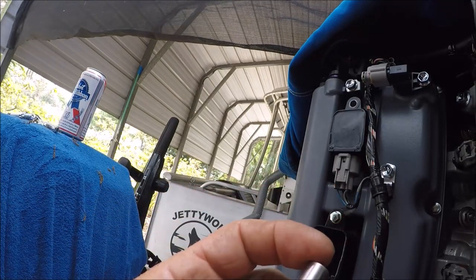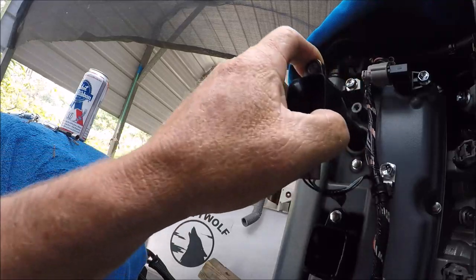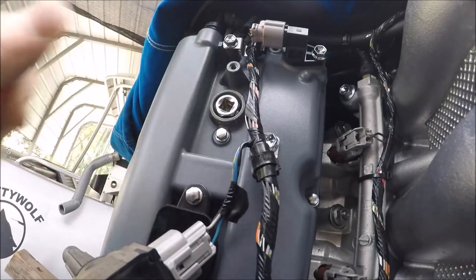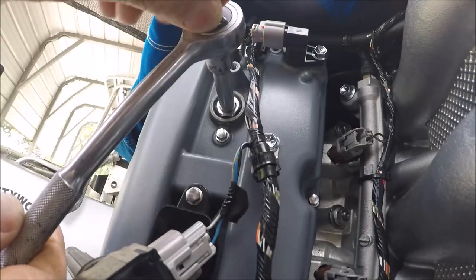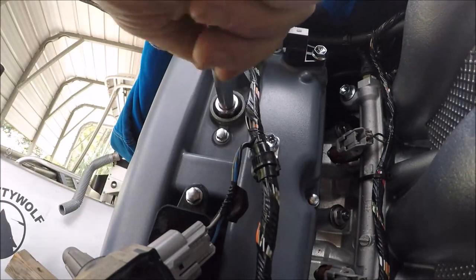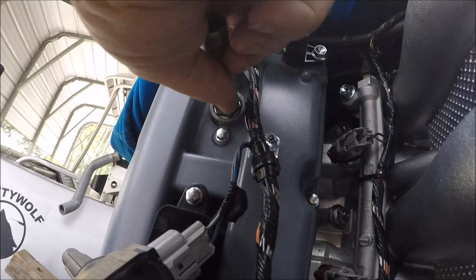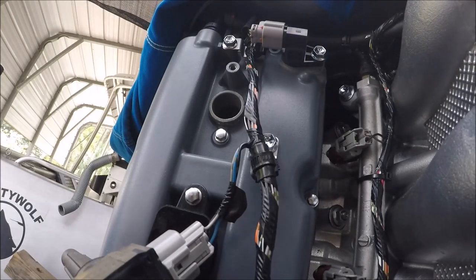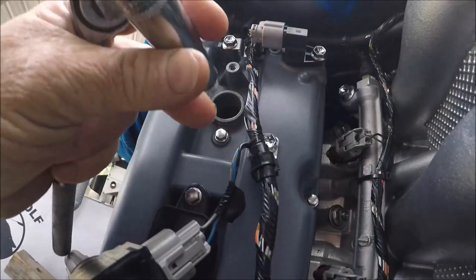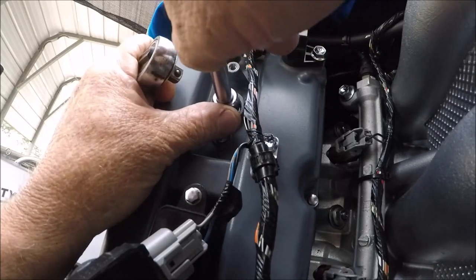The screws holding in your coils are 8mm right there. You wiggle your coil and it comes right out. This is the easy one. Stick the extra-long socket in there — that's why you get an extra-long one. Pull out the old spark plug. Then you put the new one in, put a little lube on the threads so it doesn't go in dry, and turn it in there.